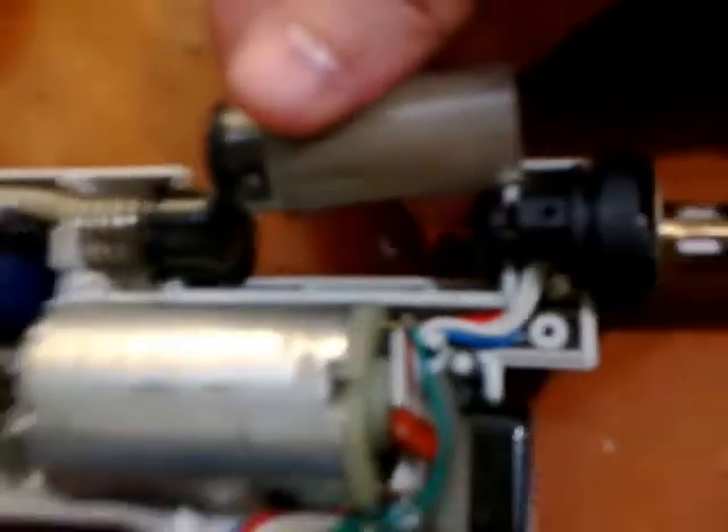There's a rubber part which opens and closes like that, which provides suction along there. Normally there's a glass capsule there which facilitates sucking it up. There are some 400 volt caps there to smooth things out, and a little cap there to smooth out the data from the temperature sensor.